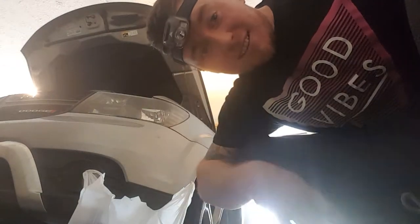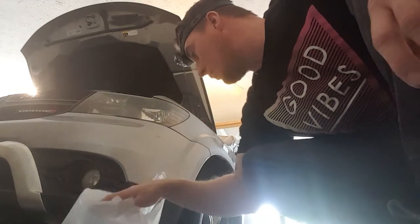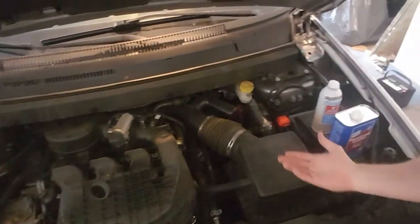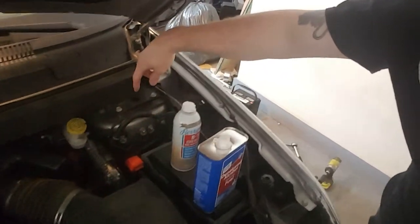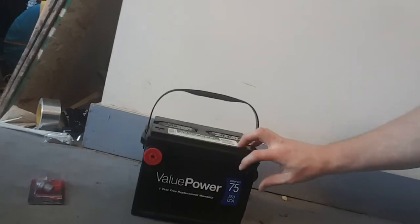What's up everybody, it's Andy's Automotive here, or National Racing Automotive, whatever you want to call me. Thanks for watching. Here's a 2015 Dodge Journey. We're going to look at replacing the battery. One of Dodge's more stupid designs — the battery is not up front. There are your jump ports, positive and ground, but the battery is actually under the left side or driver's side wheel well.